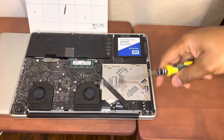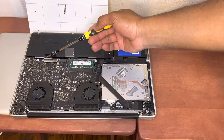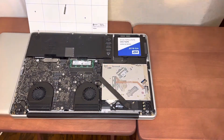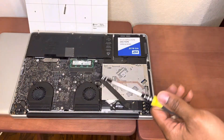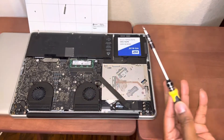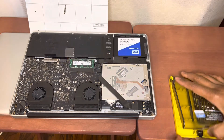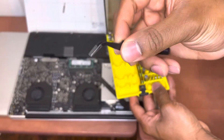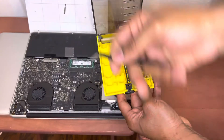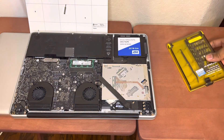Here's the part where I ran into trouble. I finished applying the paste — that was easy. Now putting all the connectors back on: this ribbon that feeds right here on this laptop, when I went to pull it in, I have big hands, and it bent and crimped. The first laptop took about an hour being careful; the second one took two or three hours just looking for a tool to get that cable on. I tried needle-nose pliers but they're too big. I ended up using a piece from the tool kit — these little tong-like crimping tools are perfect. I grabbed the connector, slid one side in, held my finger on the other side, and just kept sliding it in side by side. Once you know what tool to use, it's a piece of cake.